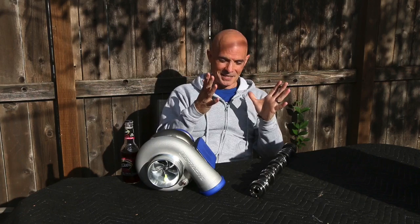There are lots of guys that take these motors from the wrecking yard, leave them the way they are, change the cam, springs, and boost, maybe put new oil in it, go out and run it, and it works — as long as it's tuned well. The flip side is there are also guys that try this and blow the motor up. If we discount those who tuned it incorrectly — too much timing, not enough fuel — where it was actually just a ring gap problem, we still have some on both sides of that camp. Some where it worked, and some where it doesn't.